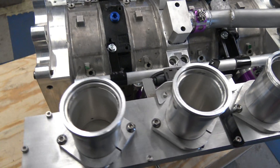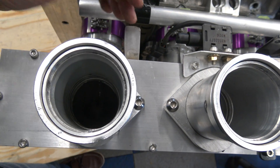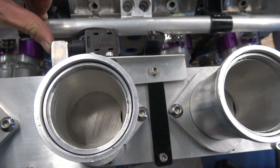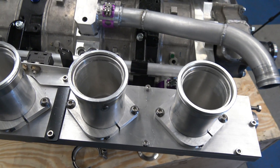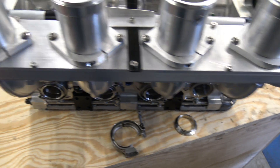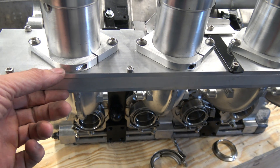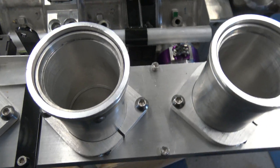This is the slide throttle intake system, which you may have seen in other videos on my race car — it's the same exact one. Basically full throttle with nothing in the way whatsoever. A lot of people complain that a slide throttle is undrivable, but I've experienced the opposite — I've been racing my car for the past seven years and it's actually extremely drivable compared to even a butterfly throttle. The benefit is obviously there's nothing in the way at wide open throttle, so you get a little more power production. I also love how compact it is — it is a little longer front-to-rear than a butterfly, but the thickness is so thin, and being CNC machined the idle gap is exactly the same on each one, so you don't need as much time tuning individual runners.